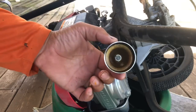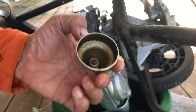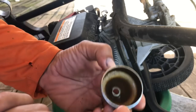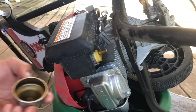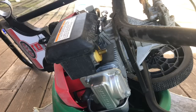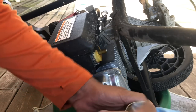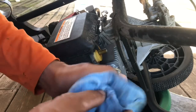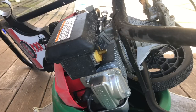Now you can see all the dirt inside. I'm going to get close — see how dark it is. That is absolutely disgusting — it's so solid, it's like sandpaper, and that's normally smooth. That's how bad it is. What you'll find with these carburetors is that a lot of the gas has ethanol in it, which causes problems when it's sat for long times. The pan is showing me straight away that there's a lot of sediment inside the nozzles and crud in the jets.